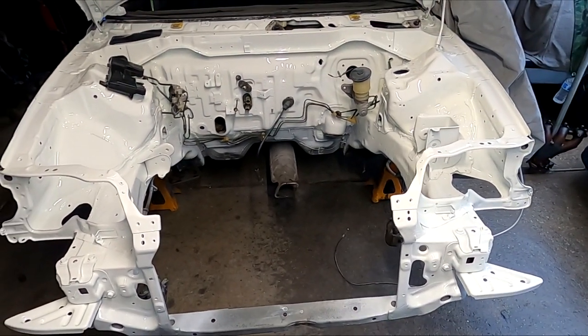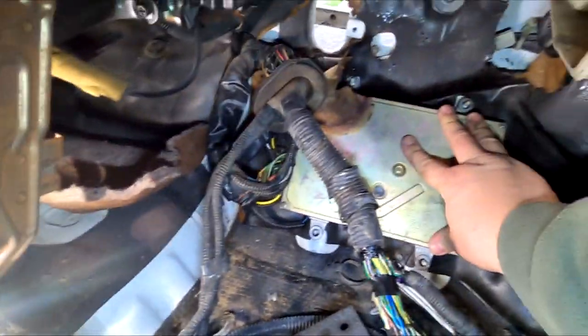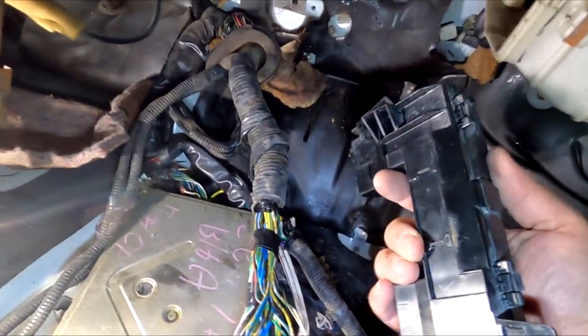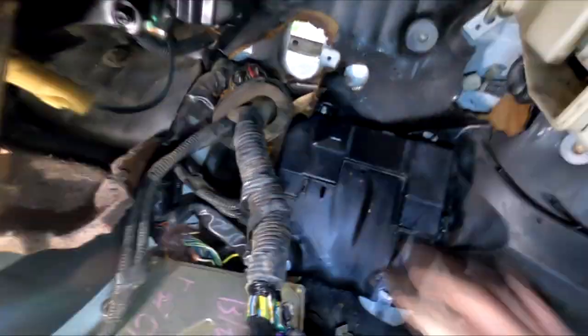not feeling it. So I am going to take the fuse box and stick it inside like I always do with all my wire tucks. And this time around, I want to keep the ECU in that position, because normally the ECU comes out and it's always chilling on the floorboard, or at least in my cars. And then I take the fuse box with one of the tabs and I bolt it to the ECU location, something like this, right?